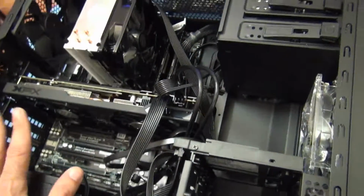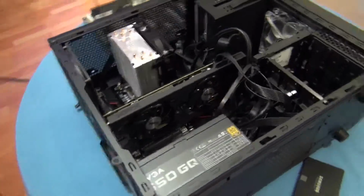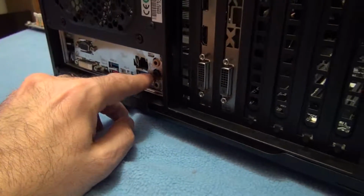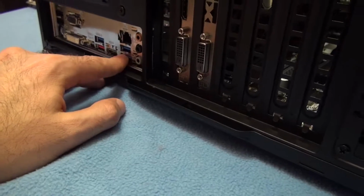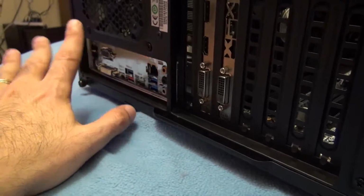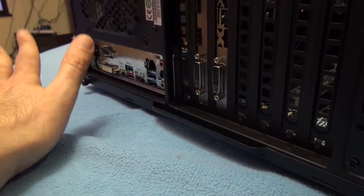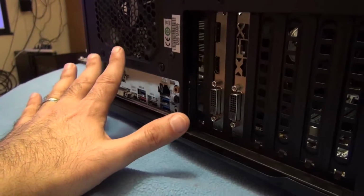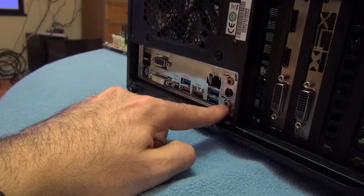The other thing that motherboards do is they tend to have audio built into them. If we look over here, look at all these plugs. This is all stuff coming out of the motherboard. So you've got your USB connectors. Those are actually very important. When you're shopping for a motherboard for virtual reality, make sure that it has what's called USB 3.0 or better. But again, that's all standard stuff. One of the advantages with upgrading a computer is a lot of this stuff is standard at the most basic level. This is where the audio channels come out.